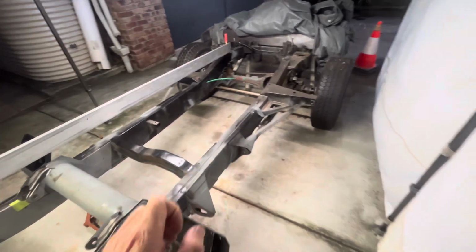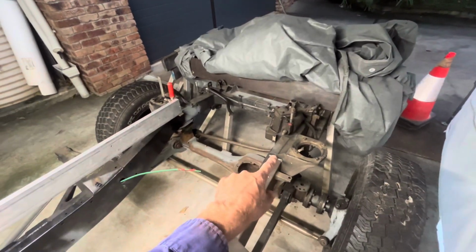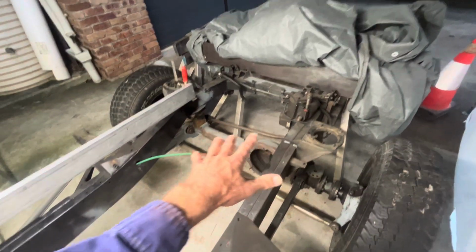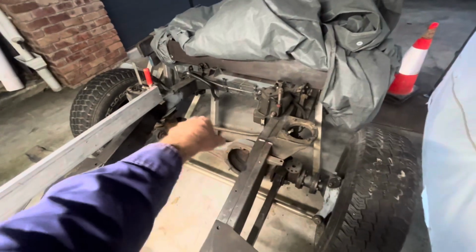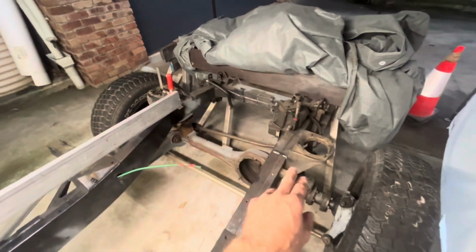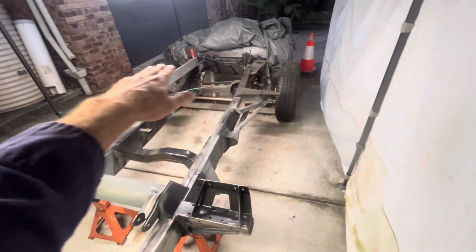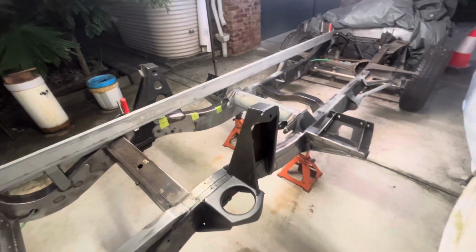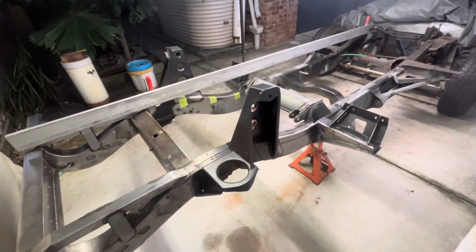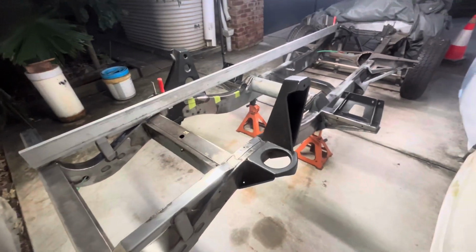And I'm lucky with my chassis that, and I've picked my spring perches because they're what support the vehicle. And I've checked some other points as well, like very front cross member on the 2 chassis rails, 2 equal points on the spring perches and the rear spring perches. And fortunately, when I get it dead level across the front, it's within 1mm across the rear. So I'm just thankful that, because I've heard the stories of blokes with some of these chassis that aren't great.